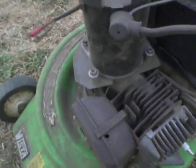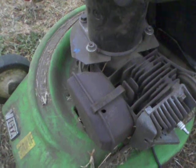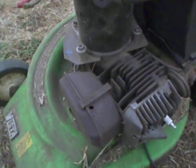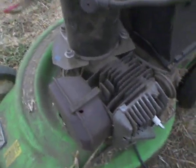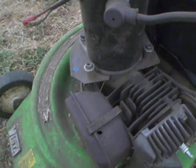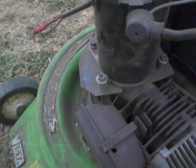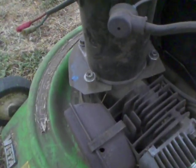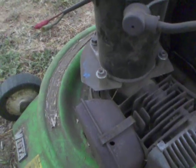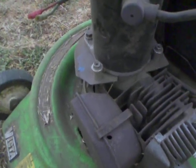We've got an electric motor there, bolted onto an adapter plate. And that adapter plate is in turn bolted onto the crankcase of what was the two-stroke engine. Because I'm not running petrol anymore, that two-stroke engine doesn't function on petrol. However, this motor has got a pulley at the end. The pulley has a hole at a strategic location which engages into a bolt on the crankshaft. When the motor turns, obviously the pulley turns, which in turn turns the crankshaft. And at the end of the crankshaft is a disc with blades hanging off it, which then cuts the grass.